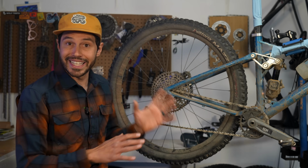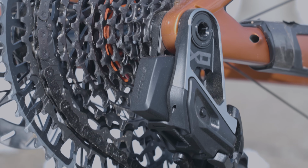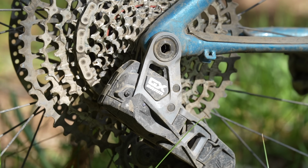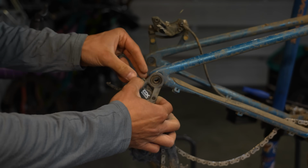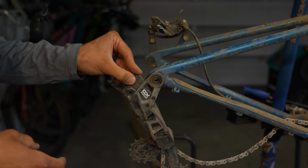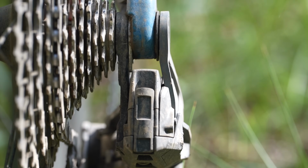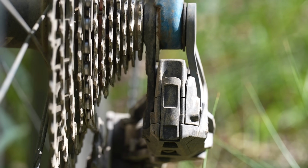So the derailleur is also similar to the other 3 Eagle transmission offerings. However, you may notice the battery location rotated 90 degrees clockwise, and it is now tucked in the middle of the derailleur. SRAM mentions that this change is to protect it from impacts better, making for a more striking appearance. So I'm not sure if this was a patent thing or just trying to make the GX a more robust derailleur, but it's definitely different from the other 3.